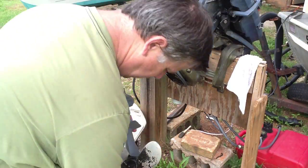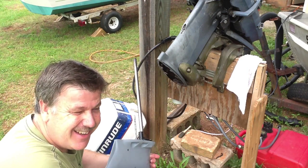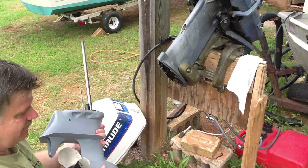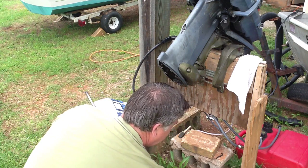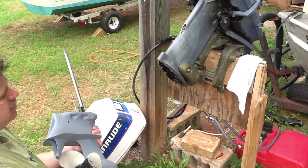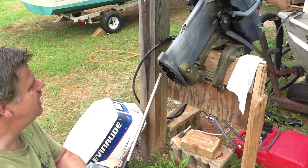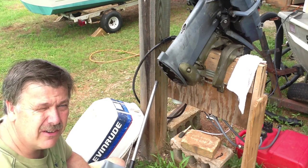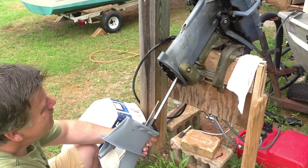Okay, here we go. The day has finally come for putting the lower unit back in to the exhaust housing. So hopefully everything fits well, and give this a shot. I've got my bolts close by. Get these spread out. I put some anti-seize on this bolt, especially where it sits in there, so it shouldn't be too hard getting out. Got the spline all greased up, ready to go up into the crankshaft, and as you saw earlier, I cleaned out any bits of chunks of corrosion that were up there in the crankshaft. So let's see if we can get this puppy in.